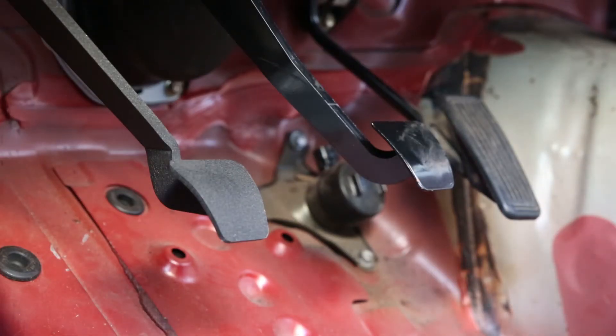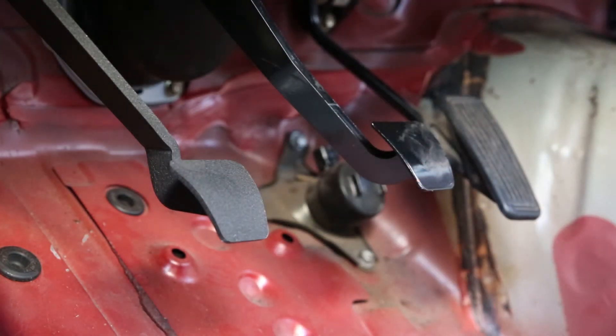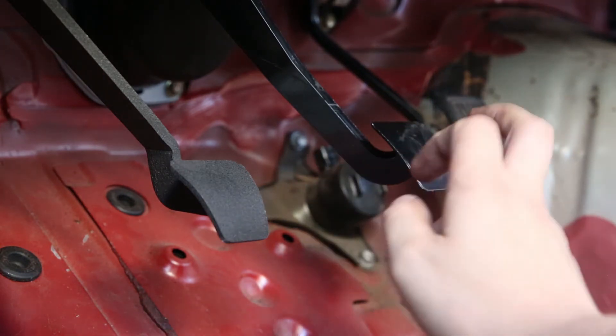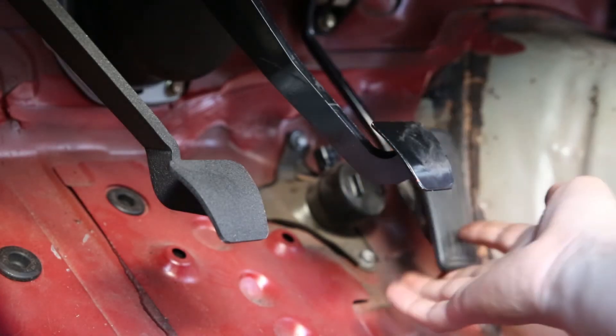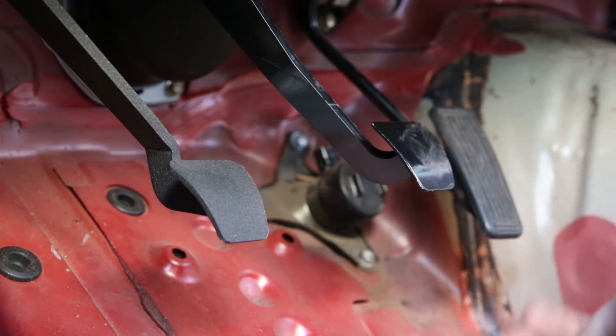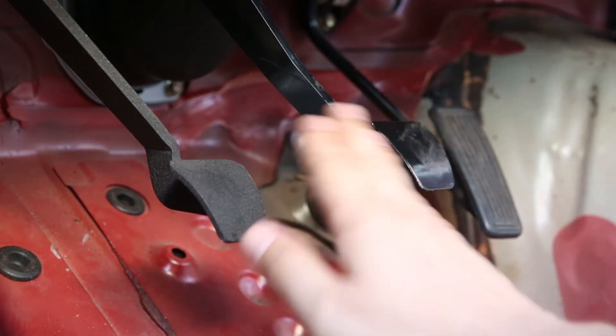Already it looks better — there's a lot more room between these two pedals. But I spent so much time last episode trying to get them all the same height, and now the brake pedal is probably about an inch higher than the clutch pedal, and they're both higher than the gas pedal. The gas pedal isn't hooked up to the throttle cable yet, so I'll hold off on that. For now I can just adjust the threads on my push rods to make these guys as close as possible.